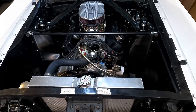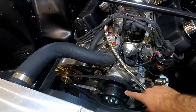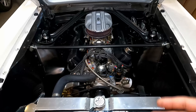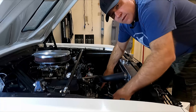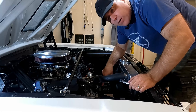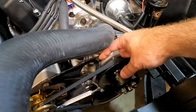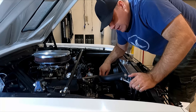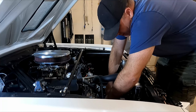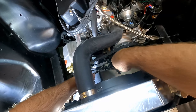Just tackle one little project at a time — that's why we're doing the brackets and the water pump pulley. It's just one little piece I can do this weekend. Let's get those parts off the car. First I need to get this alternator belt off, because I've got to pull this pulley off — there's one bolt in here that to get the alternator bracket off, you've got to take the pulley off to get to that bolt. This just uses a couple of 9/16 wrenches to loosen things up.